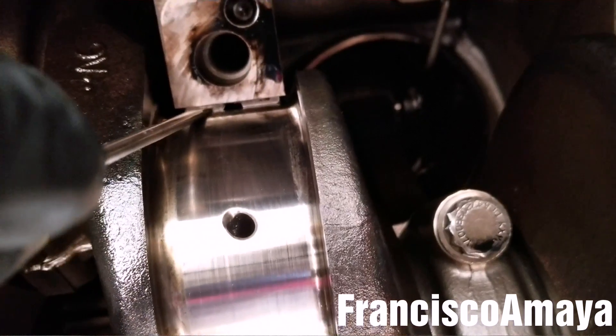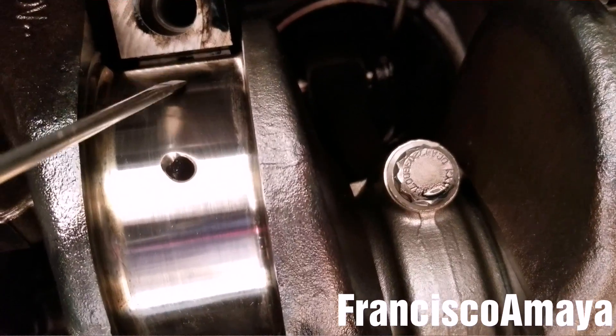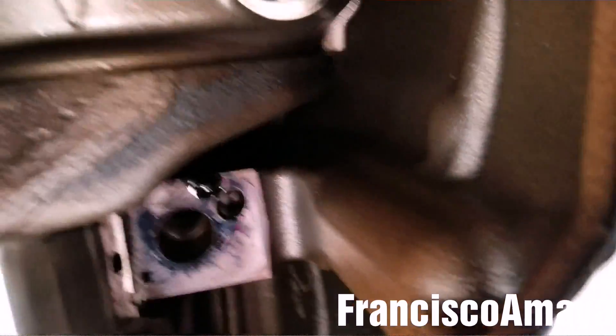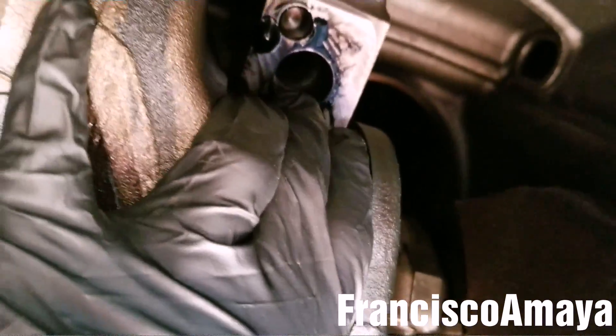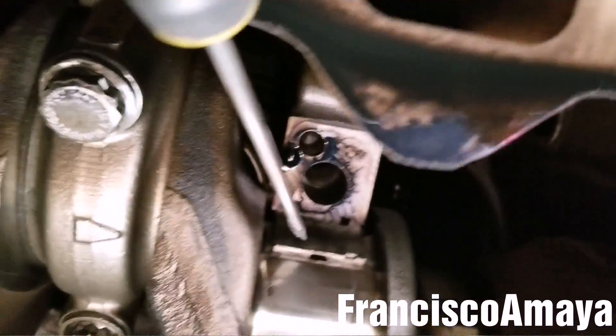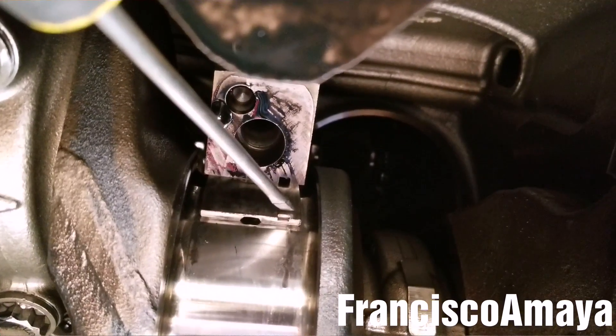Press it a little bit — you can see it goes all the way easily. Don't press it too much and don't try to damage the crankshaft. Then with the other hand on this side, just pull it like this. Sometimes it's hard, so try to be as careful as possible and get some grip. You can also use the same screwdriver and press it from this angle to help pull it.